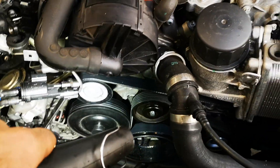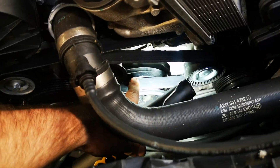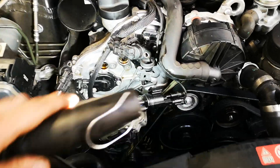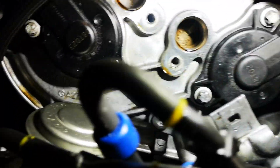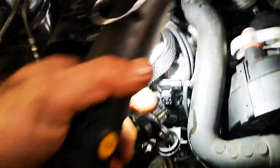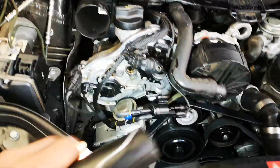27 mil socket on here — there are numbers. You look for the two symbols, the stamps to be in the center of those two holes. You don't even need to remove the sensors. Bear in mind, sometimes they will leak if the O-rings are dry. You might want to put a careful bit of Teflon on there and clean that oil up, or just a little of Hylamar, which is my favorite. Because then you'll get them sweating and leaking, which they normally do anyway.